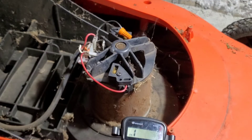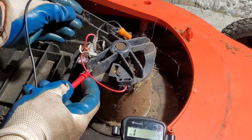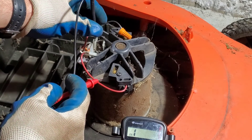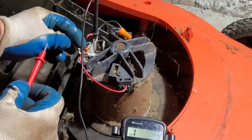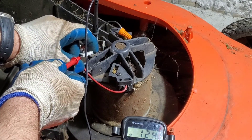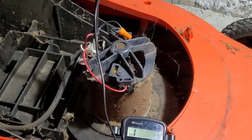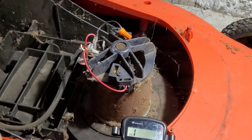I'm going to test from this block one here, and then put the other probe on the red. Because one lead has been disconnected, we're going to test going through the motor. The motor works — there's continuity. There's no issue with the wires, with the brushes, or anything else. So we've eliminated this all right off the bat.